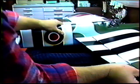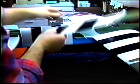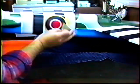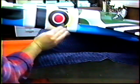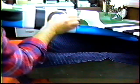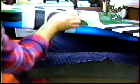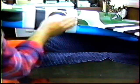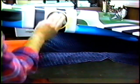Now, a couple of things we can do to make this job easier. Of course, we can take the flap off and assume it's going to come right off. Now, I've just taken some 600 paper. I'm just dusting this. I don't want to sand through. The minute the sandpaper changes color, you're done. This is why I had a coat of clear on here. And this just lets the rubber cement sit down a little flatter, especially where the letters are going to be. And I know there's going to be a little edge up here we have to work around, where these paints all the edges join. No big sanding to get it flat, just enough to get a nice flat lay down on that paper.